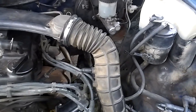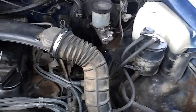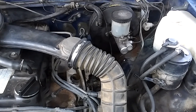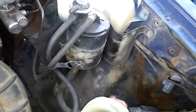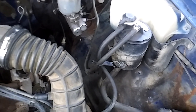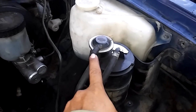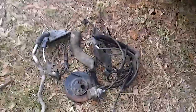Just a quick walkthrough of what I've done. I actually removed an abnormal amount of vacuum hoses that were obsolete — not necessary. This whole section right here had its own emission control setup. I removed that and ended up capping any of the inlets and outlets where the hoses connect. There are quite a few of them.